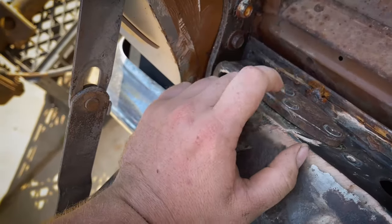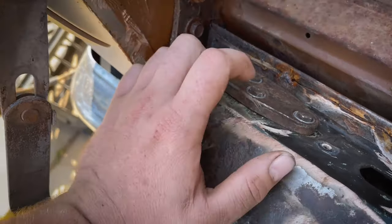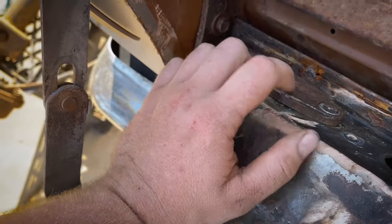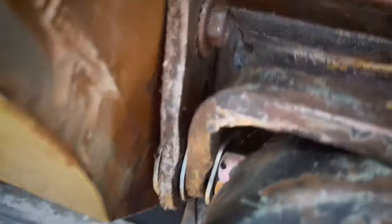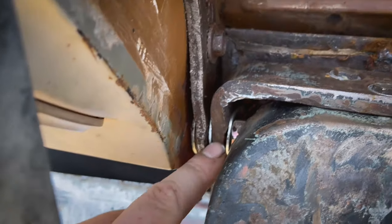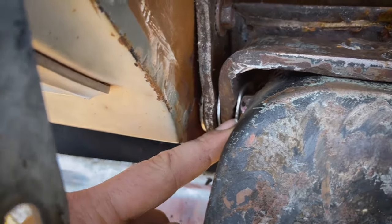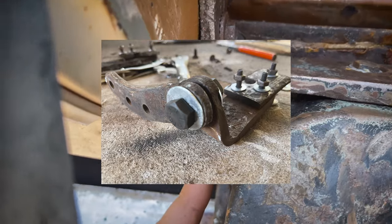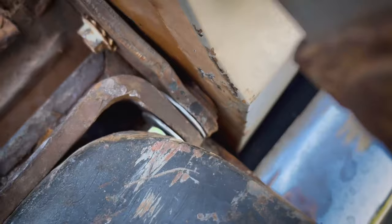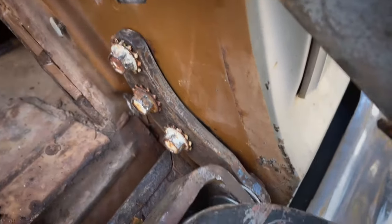These hinges were rusted solid on the original tailgate. What I had to do was drill out the holes where there used to be Phillips head countersunk bolts. I put 5/16 bolts with nuts on either end so they're no longer a captive item. I'll put a picture up on screen - I keyed a bolt to go through this hinge and put a nylock nut on the other end so it wouldn't back itself out. I then shaved the bolt head so it would have clearance against the tailgate body, and done the same for this side with three bolts into the body - restoring the hinges.